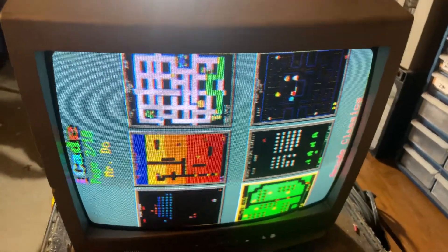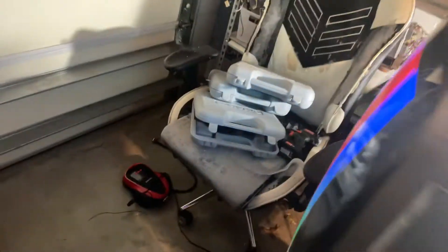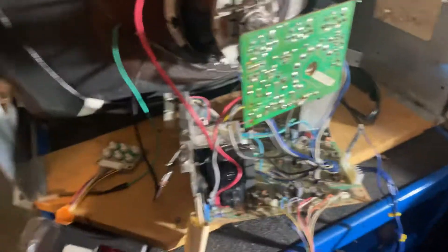It really needed nothing. It's looking good. Over here we got a K7000 25-inch. This guy's looking good. It's been on my test rig for many hours. Never mind the blotch there, that's just the yoke. This guy has been running good — new flyback caps and fuse, and we're up and running and looking good.